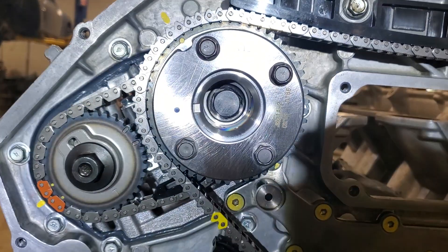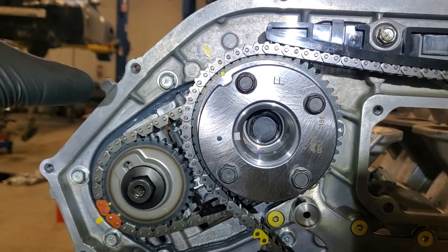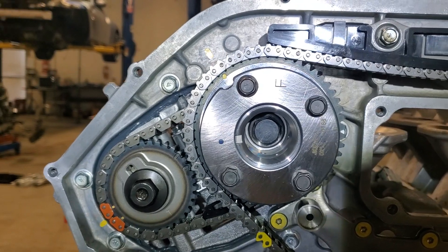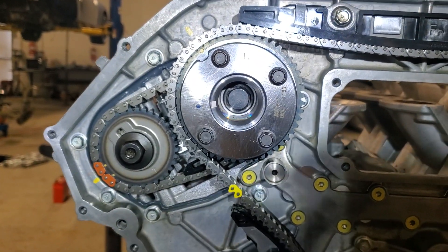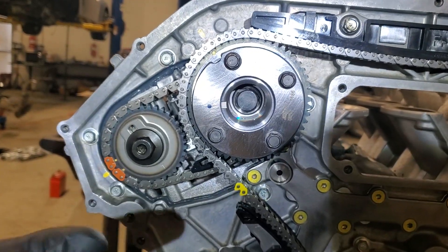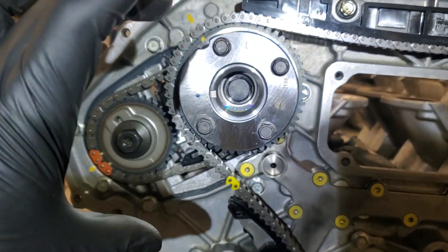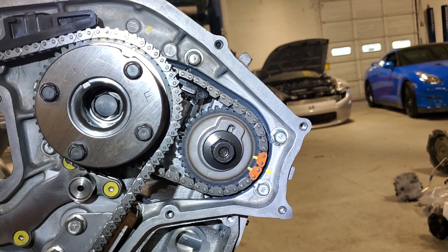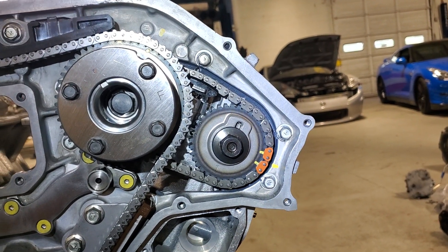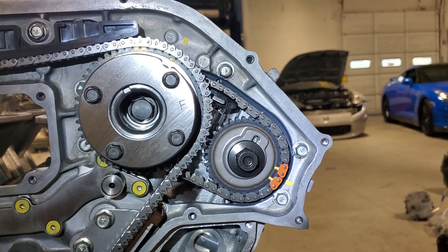You might need to use a crescent wrench over here on one of your cams to just kind of get it into a general location. Always be careful because bank one over here — these cams like to relax with a pretty good amount of tension. So always keep a good amount of resistance while you're fooling with that. I prefer to work with this side more because it's a lot more forgiving, has a lot less spring back and spring tension.